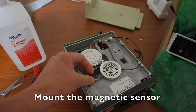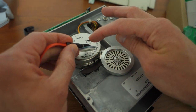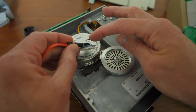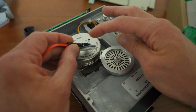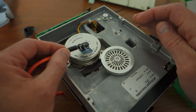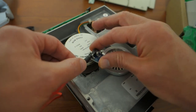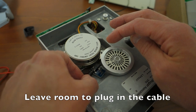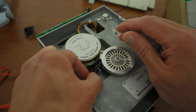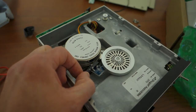Finally we need to mount the magnetic sensor. To do that, you need to bend the little wire here with the sensor to a 90 degree angle, but make sure that it's at the correct height so it's just underneath the magnet but not actually hitting it. In my case, because I don't have much room in this particular Shugart drive, I had to bend it backwards a little bit and then angle it. You also want to make it so that you can actually get the cable out again from the socket. Mount it so the sensor is directly underneath the magnet, and once it is, peel back the double stick tape and stick it down.